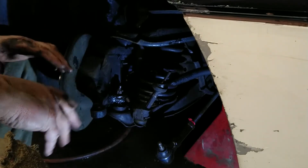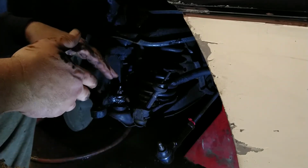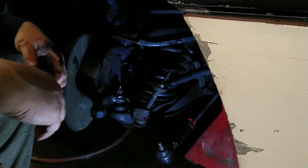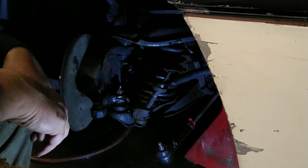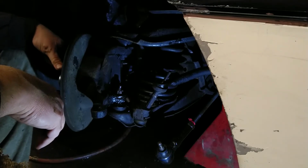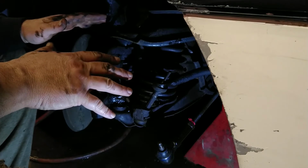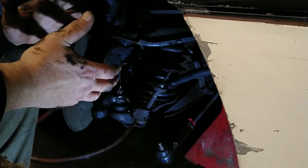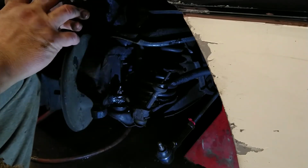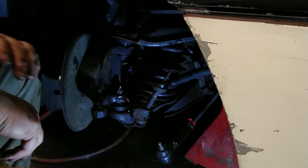You definitely don't want to do that because the spring, even though the suspension is relaxed, it's still under tension. And man, that'll kick out and hit something you don't want it to hit, and then you're explaining to your insurance company why you were doing this, or worse. So yeah, don't mess with anything, any kind of potential energy, like a compressed spring, pressurized cylinder, those kinds of things, they don't give you any warning.